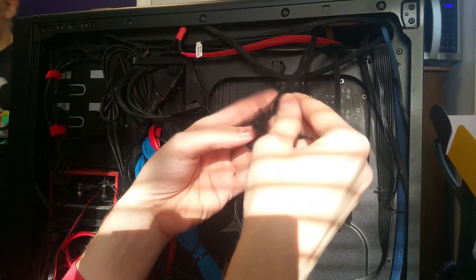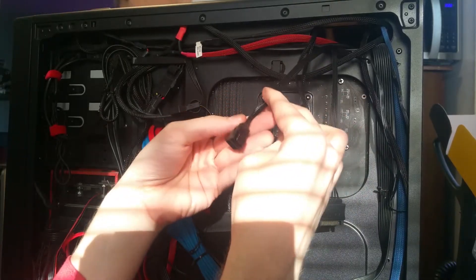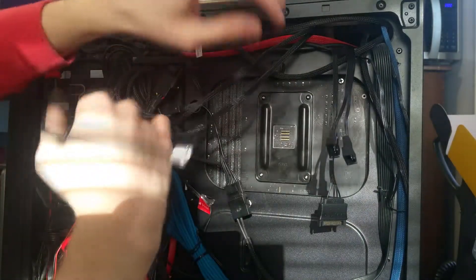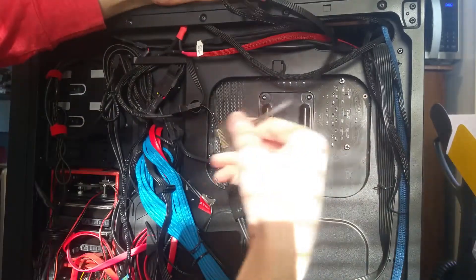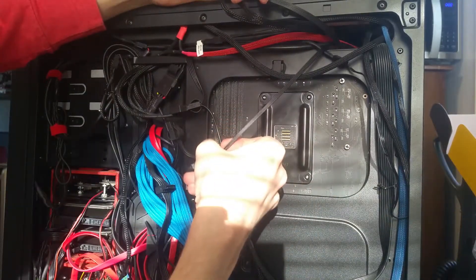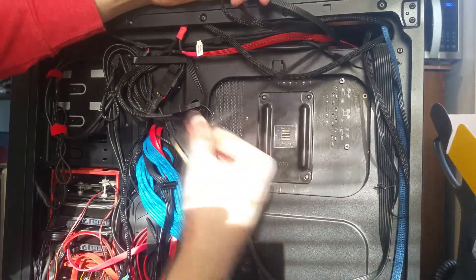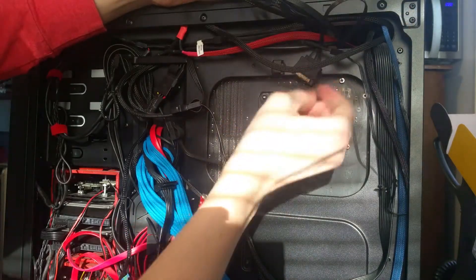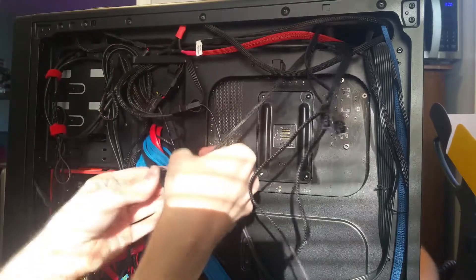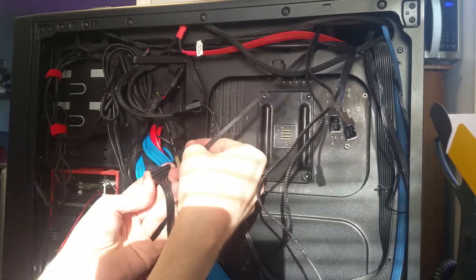This particular cooler powers the fans itself, and these are the items that do that. I've got to plug these into those and these into these. This needs to go into this because this pump actually draws power straight from the power supply instead of from the motherboard like other pumps. They gotta be special, they gotta be chunky.